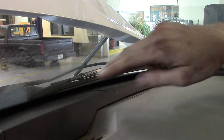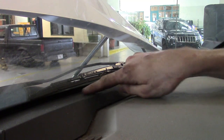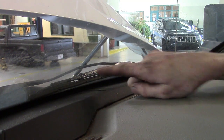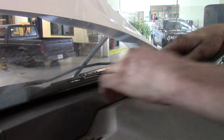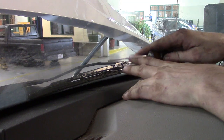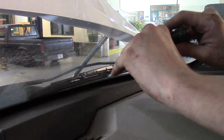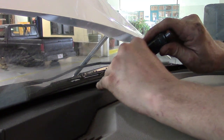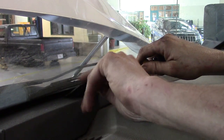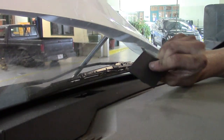There are two bolts that go along the top of the dash — they're up under plastic square covers. Here's one of them now. They're kind of hard to get to because you've got the windshield right here. A plastic trim stick probably won't fit down in there, so we've got to get a small screwdriver. I don't really like using it on plastic but in this case I don't have much of a choice. I need to get to an edge and try to pick it up. There we go, we've got that one out of the way. We've got one on the passenger side and one on the driver side.